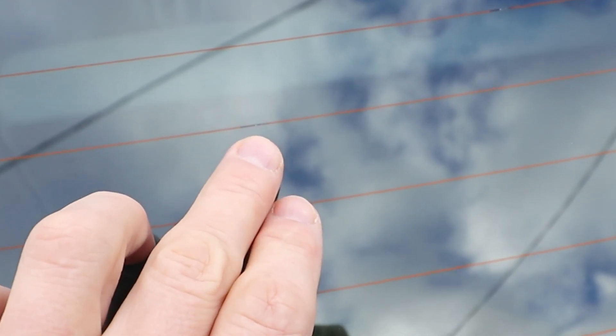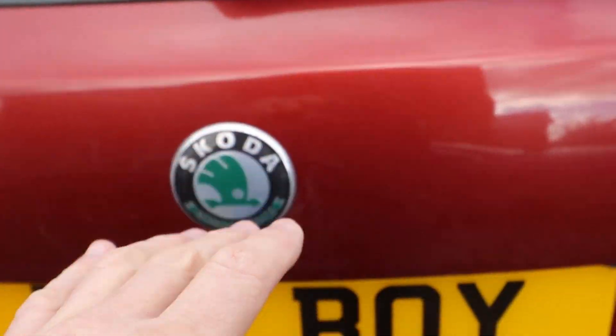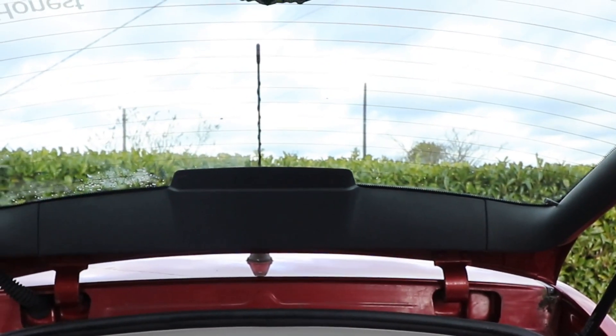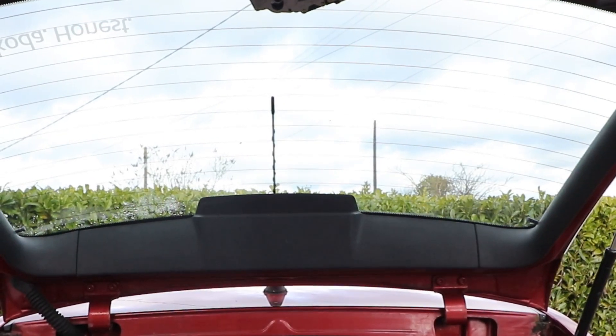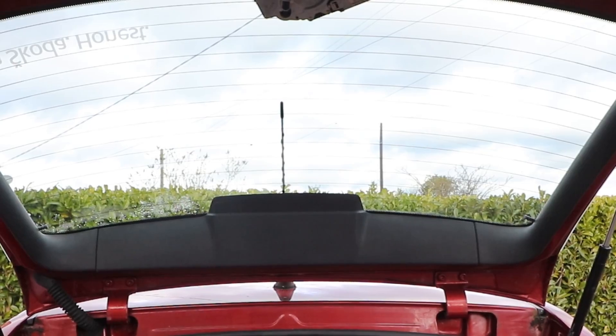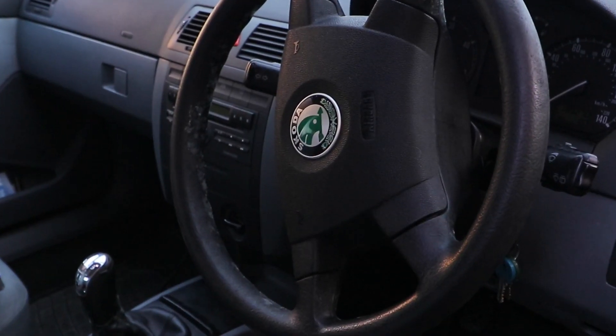Try and repair them with some electrical contact paint that's specifically designed to work on these. You need to open up the boot and look on the inside, as that's where they're attached. This is of course one of the main failings of these surface-type demisters — when we overfill the luggage compartment, we often close the hatch up against things, potentially damaging the demister line elements.